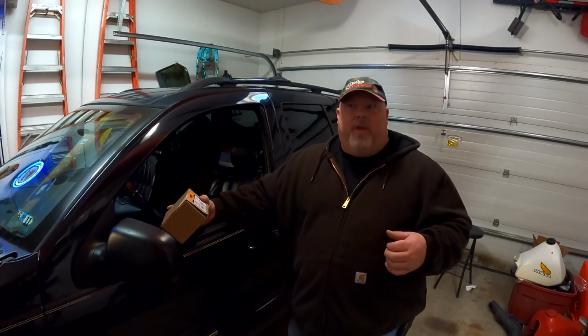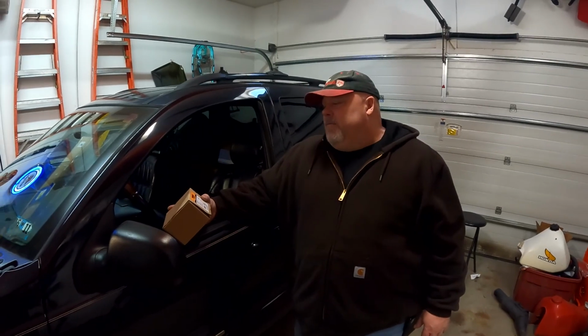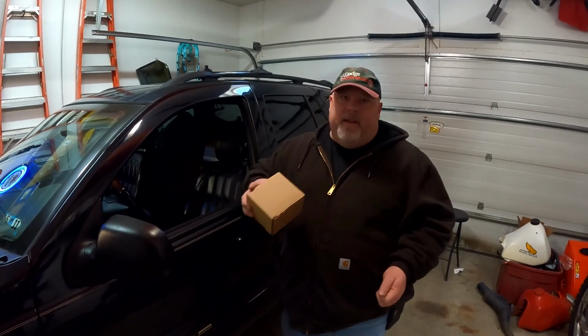When the airbag light's on, it means that something about the airbag system is not functioning correctly, and so they won't deploy. So it's a safety thing, plus it's annoying to have it go ding all the time when you're driving. Oh, does it ding every time? Yeah, it dings every time it comes on, right away when you start the vehicle. Sometimes it goes out for a while, but then when I'm going around a corner, it comes back on and dings again. There are a few different things that can cause the airbag light to come on, but this is a really common one. And I figure since it's happening when I'm steering, it's probably the clock spring.